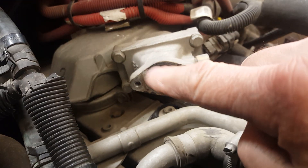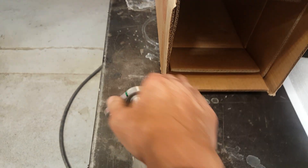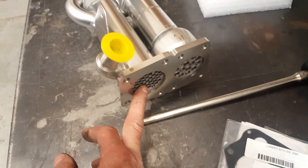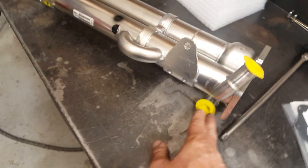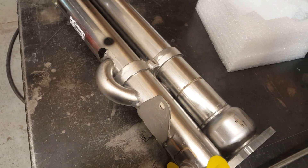We've got a new one here and you can see it's a direct exhaust manifold hookup, EGR valve, and then back out to the intake. That's why we get white smoke — it's burning coolant. These are the coolant lines, and this is a cooled exhaust system going to the intake.